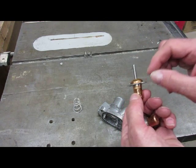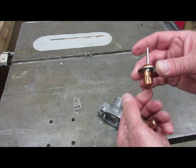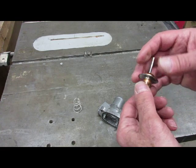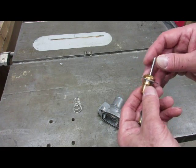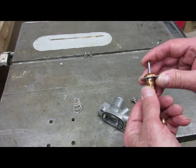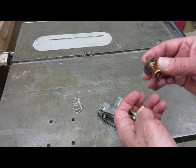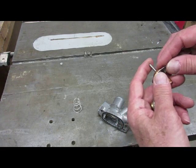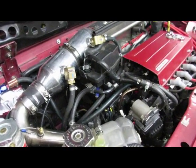What I'm going to do is a little experiment to see if I can modify this valve on its own. I've already tested it - it does open around 176-178°F. But let's see if we put a couple more dimples in here, would it be possible to make it open at 160°F or maybe 165°F, for those of you that would like the thermostat to open a little sooner.